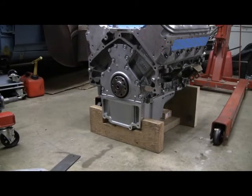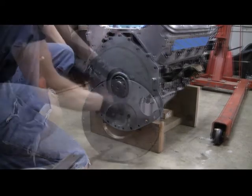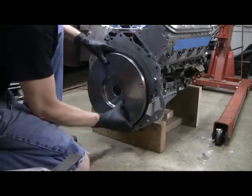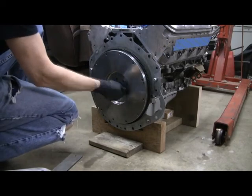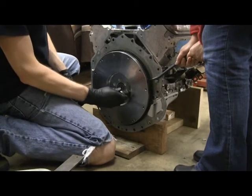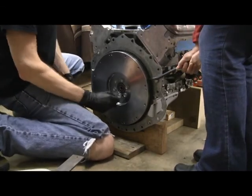I'm going to go ahead and put the flywheel on at this point. I can't get the harmonic balancer on without the flywheel on because I can't hold the crank. Make sure the surface of the back of the block is nice and clean, same with the protector plate — put it in place. The dowel pins will hold it, then torque the bolts down to 75 foot-pounds. I also had to buy new flywheel bolts — I bought stock GM bolts that come with the Loctite already on them. Final torque to 75 foot-pounds. Just so you all know, my wife is out here helping me hold the flywheel.